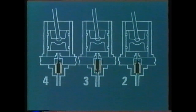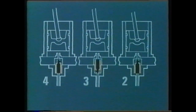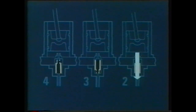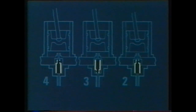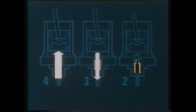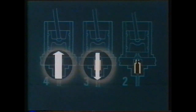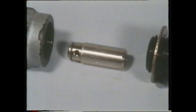Therefore, in a three-gear change situation, what will be the result of a restrictor being fitted the wrong way round in an up-gear change sequence? When second gear is released and third gear is applied, second gear comes off at the correct speed, but third gear — because of the wrong airflow through the restrictor — goes on too quickly. The result is band overlap or a momentary two-gear situation. On the gear change from third to fourth, a similar situation in reverse will occur. When third gear is released, because it has only one air escape path instead of two, the band will come off too slowly, while fourth gear will apply at the correct speed, causing a band overlap situation. So remember: always ensure that restrictors are fitted correctly, and that it's the correct restrictor that you fit.